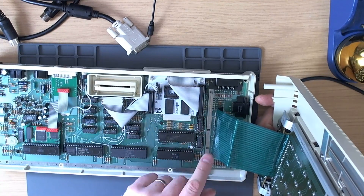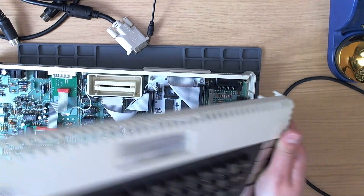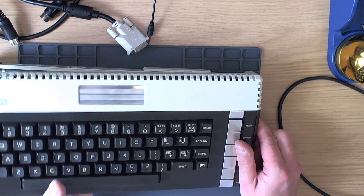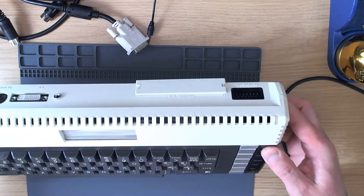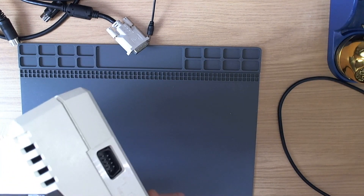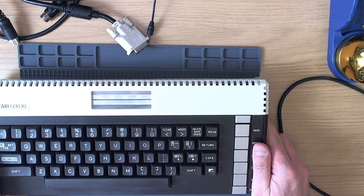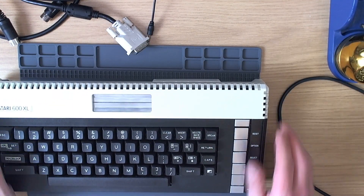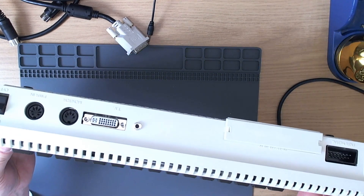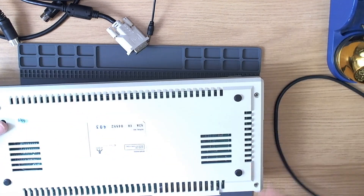I just wanted to clarify from the previous video: when I was trying to put the machine back together and it seemed to be blocking on top of the Ultimate, it wasn't actually that - it was this daughter board for the keyboard. This tends to drift over to the right, and if you just nudge it so that it's more or less upright, you'll find the machine goes together no problem at all. It's just sitting loose on the bottom of the case - it's a perfect fit. Once the strain relief clips are off the Ultimate One Megabyte, you have no problems whatsoever with fit and finish internally.